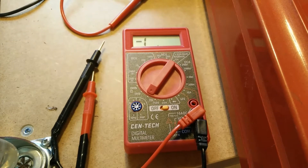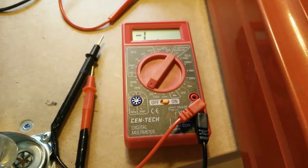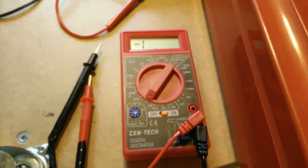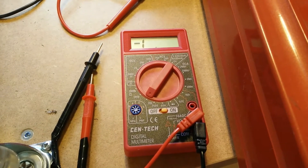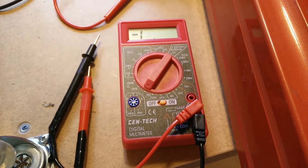The first time, the fuse inside of it blew up. It's kind of hard to find the fuses — these tiny glass ones. So I got a new one and put it in. It ended up being a half amp normally, and I put in like a 7 amp.